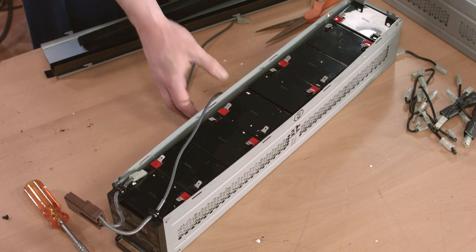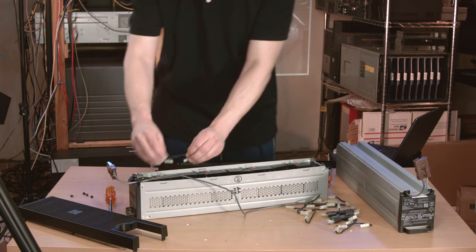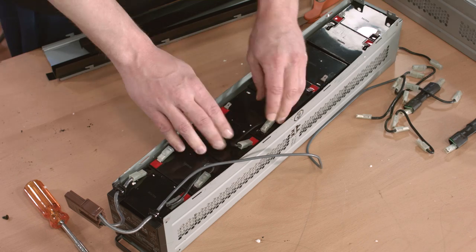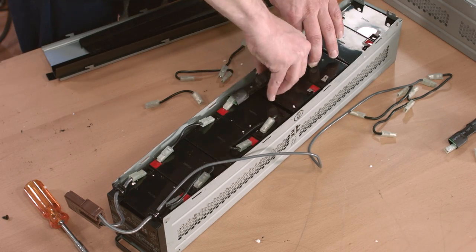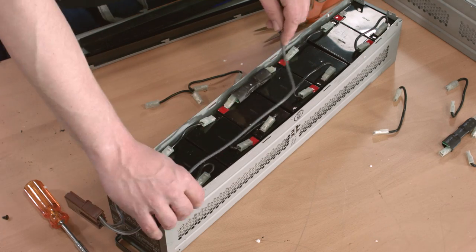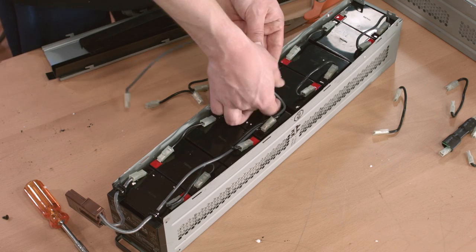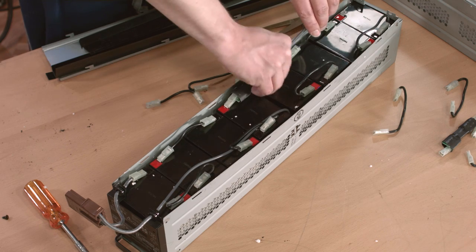Front to front and ass to ass. Here's the wiring in detail — I'll speed it up a little and show you the finished arrangement at the end. By the way, I realized that I'd forgotten this big fat jumper. I'm assuming that it's a thermal cutout, so that if the battery pack overheats, the voltage is disconnected. It seems to fit just right in the middle of the pack, and I figure that's the best place for it. The long UPS lead is bent in a particular way, and there's a little spacer on the bottom of the tray between the four batteries on the right and the four on the left, so I'm assuming it's meant to tuck between them and follow out the other side to the open terminal at the back.